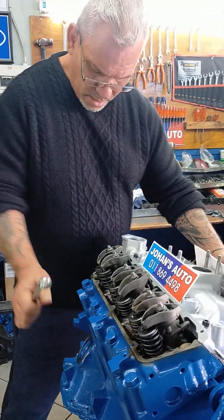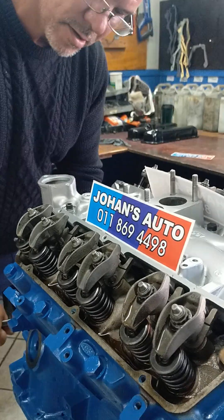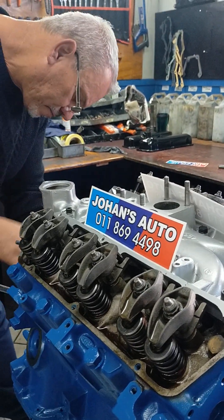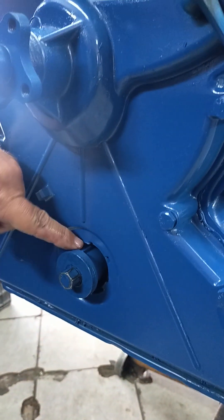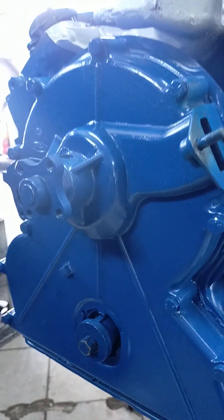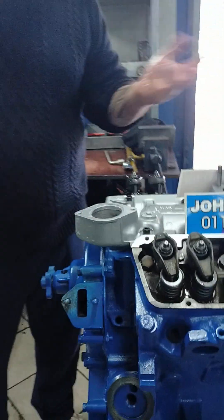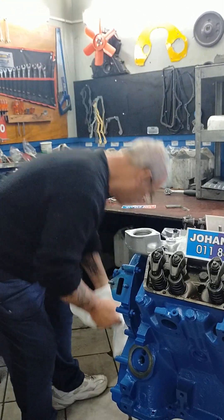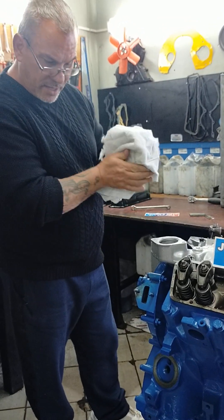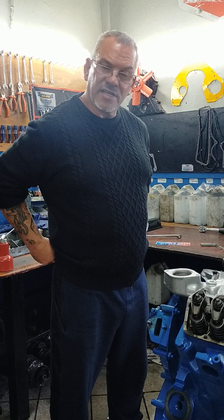Now to make sure you've set all of them — let me get this engine level. Number 5 will be the next one to rock again. Now to double check that number 5 is locked properly, you will come to the front of the engine, you will find your keyway. Your keyway will line up — and that means that your timing is now spot on, your cam timing and such. You can now put your distributor in before doing anything else, and that will help you know that it's not 180 degrees out — it will be in at the right place. Best thing to do now: wipe your hands, always try and be neat and clean, and finish your engine. I hope that was helpful. We'll be posting this video shortly, and we'll be posting the sequence in a format you can read and download for yourself. Thank you for watching. Bye.